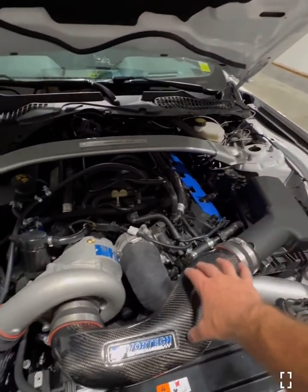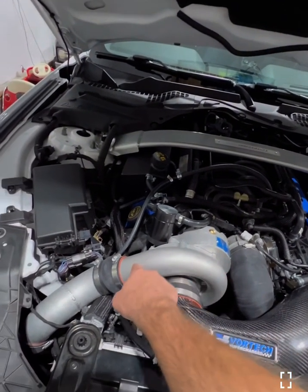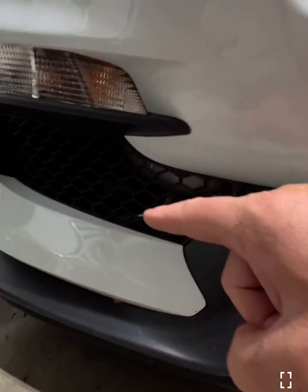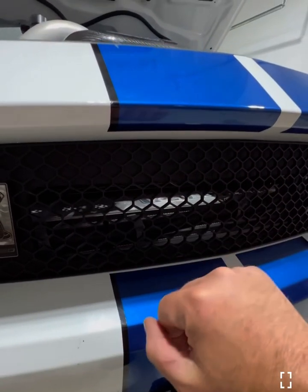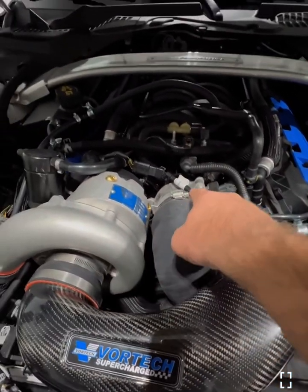The air is coming through the intake, it comes through the intake air tube, and it's being sucked through this turbine which is building boost and power. That's coming right down through that intercooler intake charge tube, going down through there and coming around right into this intercooler. That's a Vortec intercooler that sits in front of the radiator for the car. It's running through that intercooler, then running back up through this charge pipe and straight in through the throttle body and into the engine.